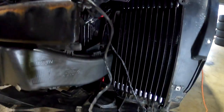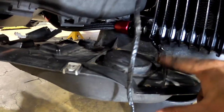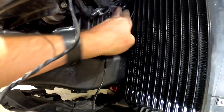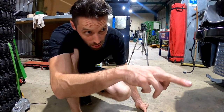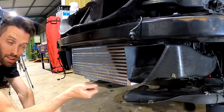Here is the final assembly of how everything's going to sit. We ended up with more than enough room between the bottom of the cooler and the bottom of the splash guard — so if we do accidentally bump any driveways, we've got a good inch of compression before it'll be hitting the cooler itself. Got all the ducts back in place on both sides and everything's going to sit down there. This is the first time I've ever used AN fittings, and I did manage to absolutely destroy the first one cosmetically when I put it on, which is a bit annoying, but very impressed with them. Crash bars back in place — I think it's time to put the front bar back on. The trans cooler mounting is actually higher than the intercooler, which sits further forward, so you'd need a big crash to impact and cause a leak.